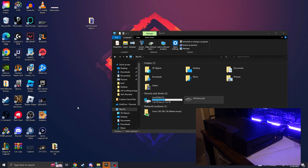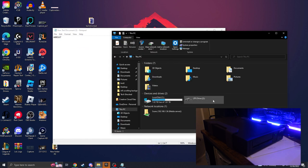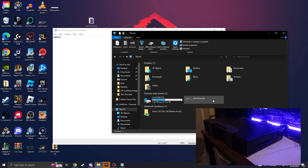It goes through this whole startup process to make sure none of the heads are broken at all. Honestly, it's not that bad. Alrighty, I'm gonna take note first before anything. We're just gonna make a text document and write down the numbers on the barcode that's provided. This is usually for tape drives, but be sure to write it down as it does ask for it when you format the drive, as you see right here. So we're gonna put it in the drive.